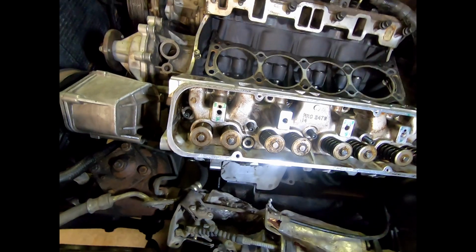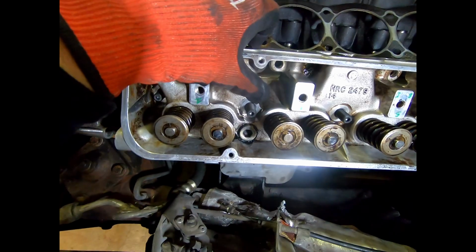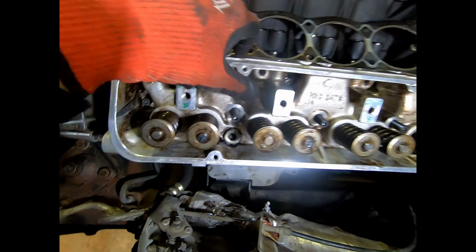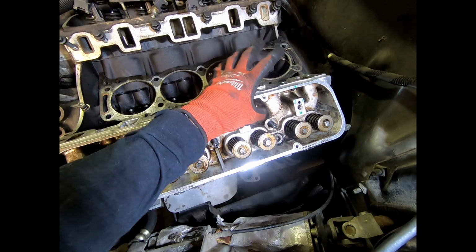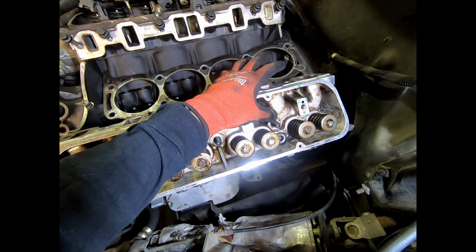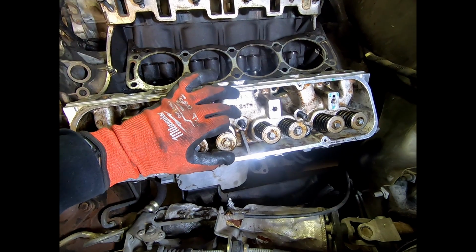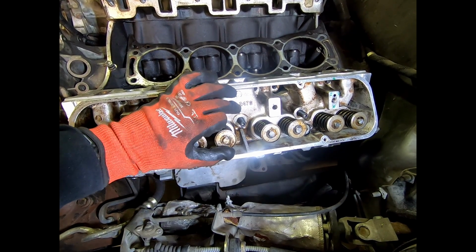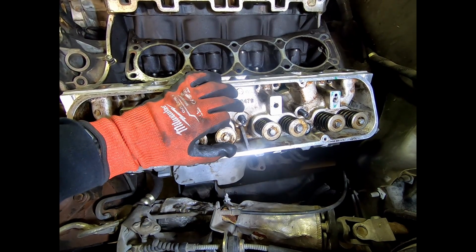Next, well, I guess the predecessor to that is these shoulders here, where the washer is going to seat. You want to get those very, very clean. This one has some staining on it, but it is quite clean, to the extent of putting brake clean or carb cleaner on a rag and wiping that surface down, because the pressure of the nut goes against the washer. The washer has to be seated on that and planted on it without spinning.